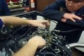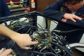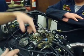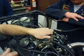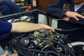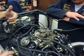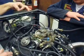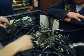Choke plate closed. Release — lowest step. This would be when the engine's hot at operating temperature. Car sits overnight, car's cold. We need to restrict air so we get more fuel. Customer steps on the throttle, and all by itself this tension in the choke thermostat pulls this up to the highest step. When adjusting timing, it is imperative to make sure that's at the lowest step.